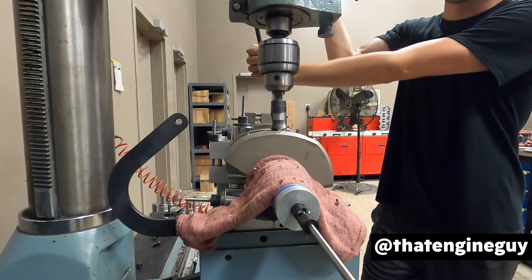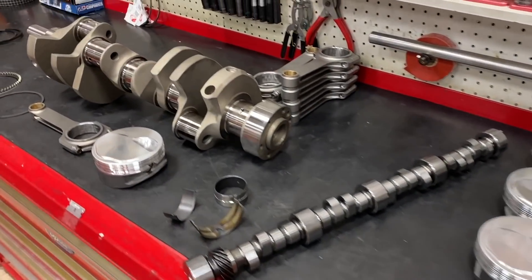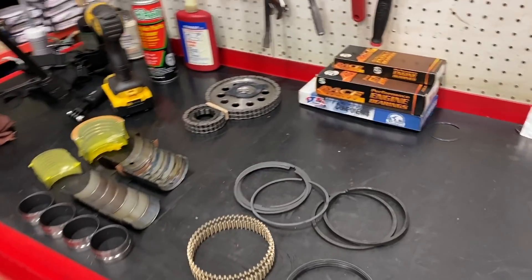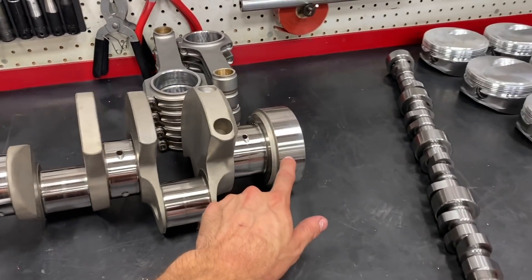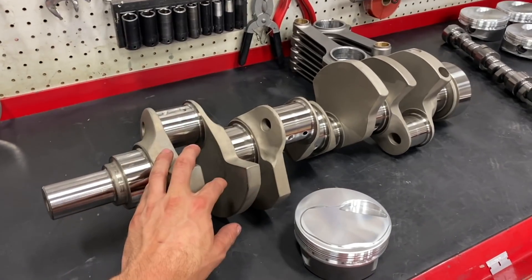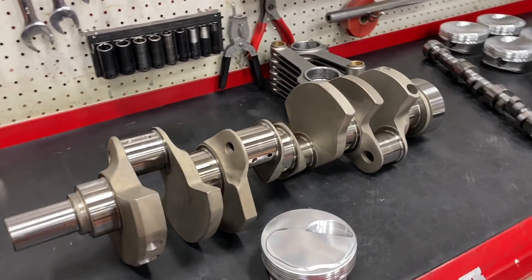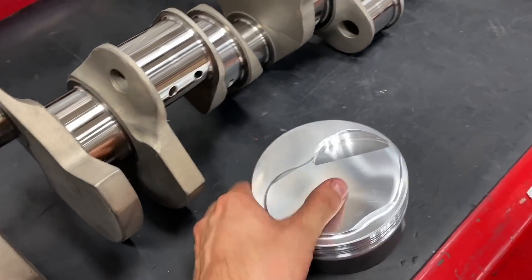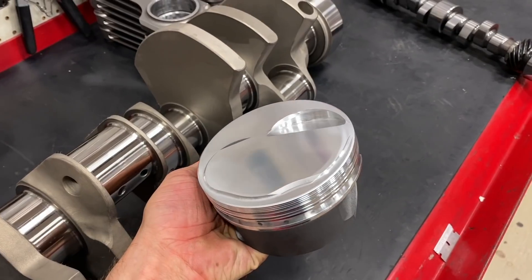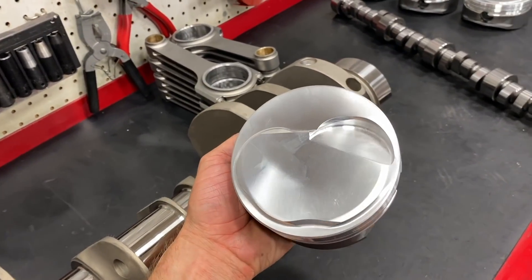Jacob here with Smetting Performance in Texas. Last time you saw me I was balancing the crankshaft and honing the engine block for Zach's 572. Today I'm going to go over all of the components we're going to use in this engine, as well as actually assemble it all into the Dart Big M engine block. We have a 4.25-stroke one-piece rear main seal big block Chevy crankshaft, forged out of 4340 non-twist forging steel. It's internally balanced and a very high quality, very strong piece. Coupled with our massive 4.630-bore piston with a little dome on it, that's going to give us 572 cubic inches. These pistons are custom made by JE for us.